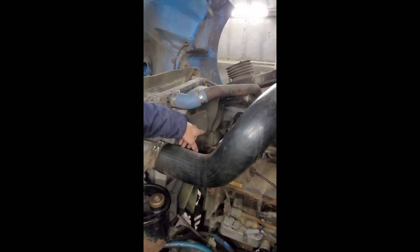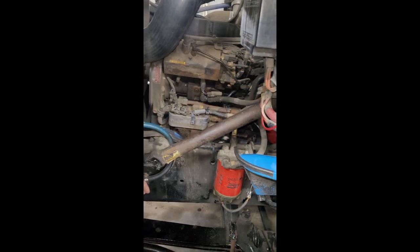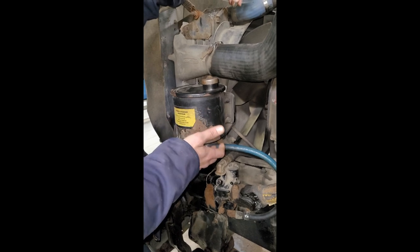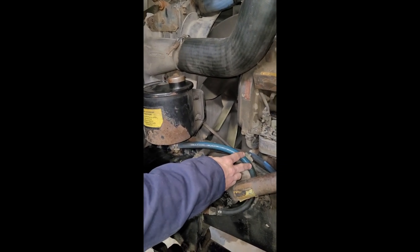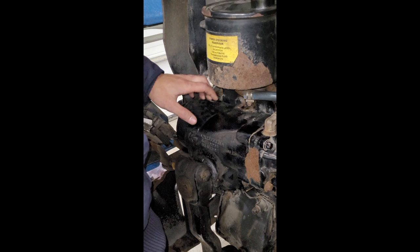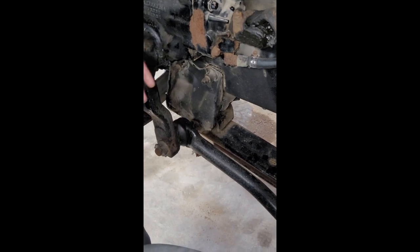The radiator fan cools my radiator, which in turn drives my water pump that sends coolant into the engine, which in turn drives my alternator that supplies electricity to my batteries to charge them. I've got my steering shaft and knuckle — properly secure, not cracked or broken, no illegal welds — and my knuckle should be greased. I've got my power steering reservoir that's properly secure, not cracked or broken, not leaking, and filled to the proper operating level. My power steering hose is properly secure, not cracked or broken, and not leaking. My gearbox is properly secured, not cracked or broken, not leaking, and is also gear-driven. I've got my pitman arm and drag link that are properly secured, not cracked or broken, no illegal welds — they're held together with castle nuts and cotter keys.